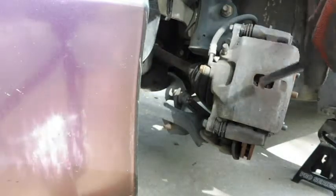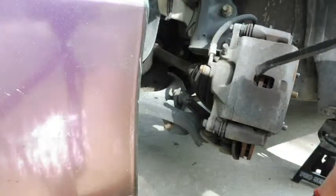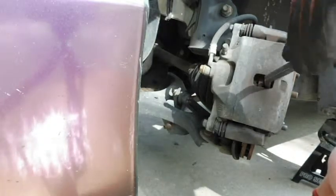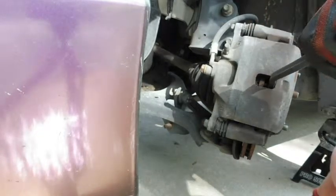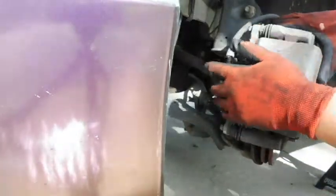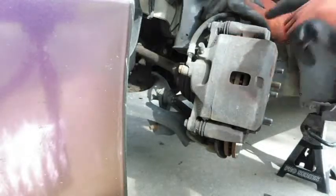What I like to do is go ahead and compress the piston a little. We won't have to compress it much anyway because we're not putting on new thicker pads like when doing a regular pad change. I'm still going to compress these a little bit just to make it easier to get them on and off. I'll stick a pry bar in here and kind of pull it up — that loosens up the caliper there. I'm going to take the caliper off first and then the bracket because I want to take these pads out so when I paint these I don't get paint all on the pads and the hardware.